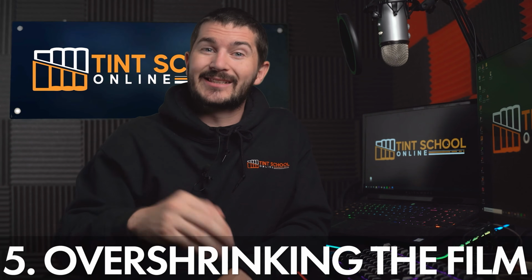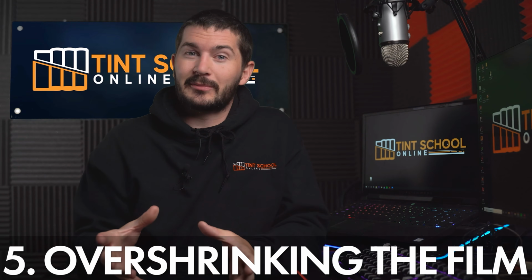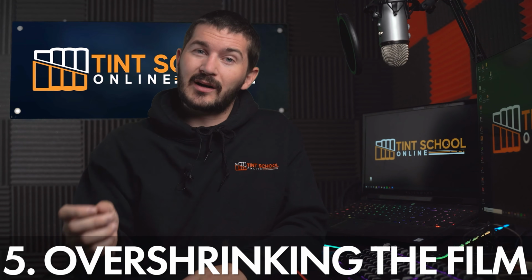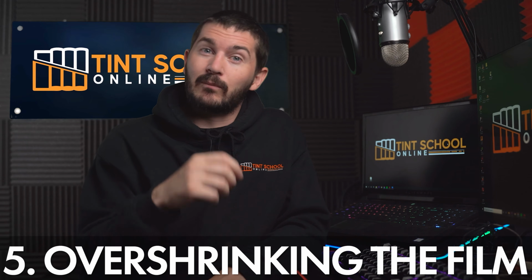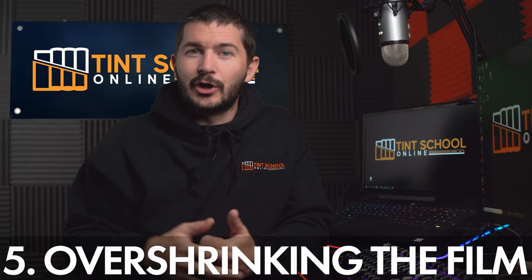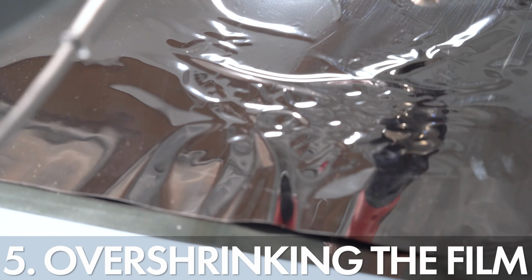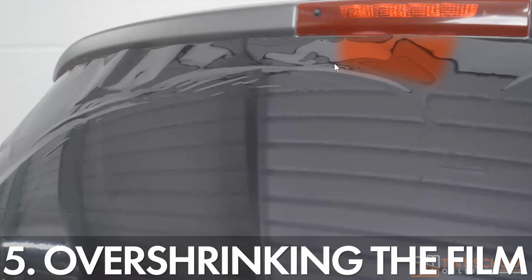And number 5 is over shrinking the film. So this is another common mistake. You're going to need to understand what is shrunk and what isn't shrunk, and when it's ready to be pushed out. You don't want to nuke the film if it's already shrunk. This is why we talk about the shrink line. So as you can see here, this is my shrink line. So this finger is coming from the bottom, which means it needs to be shrunk, whereas this above the shrink line is already shrunk and can easily be pushed out.